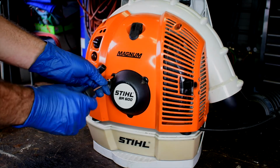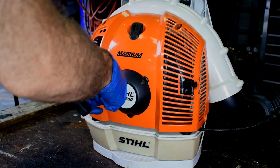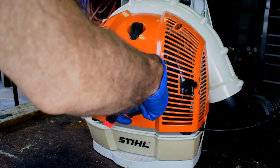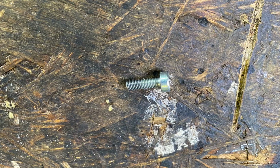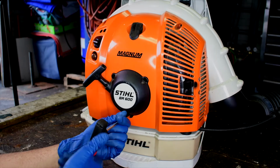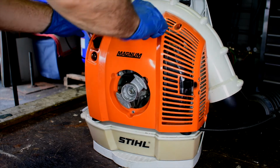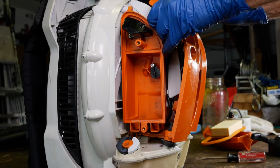And you'll have to take off the starter pull cord. If you notice, the screws that I took out earlier were more aggressive screws for plastic, and here's a picture of the plastic screws, and these are machine screws, and these are like finer screws. Here's a close-up picture of those. And to get the cover off, you'll have to pull the spark plug wire, and it goes straight up like that. And just work it through there.